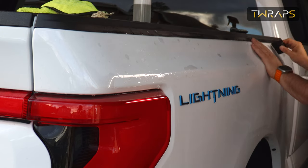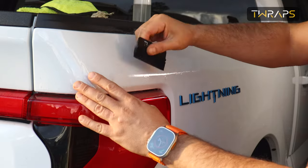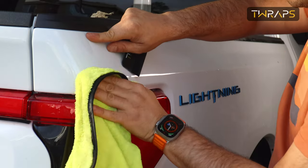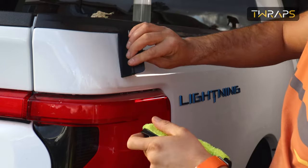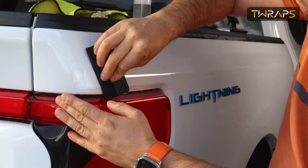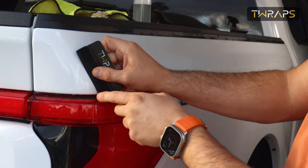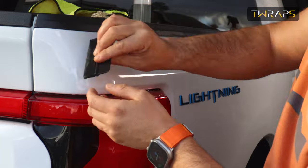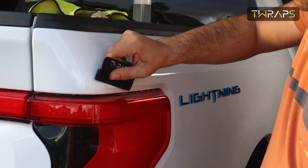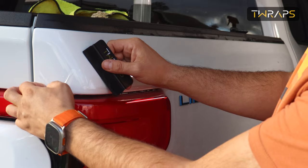Now we need to work on the design. I'll remove the water — you get a little pressure here. You can use a microfiber to try to get the water out so that it soaks into the microfiber. And if that doesn't help, you can grab another water bottle with just clean water and spray clean water at the adhesive, and that should make it stick. Last resort, if you're having issues with this curve, is to use a heat gun or a hair dryer to warm up the film, in which case it would become softer and conform to this shape much easier and it will stick.